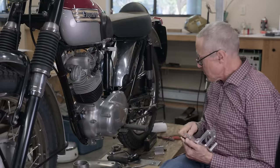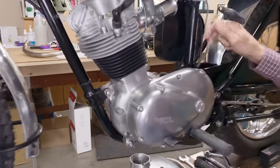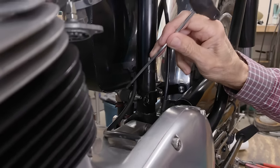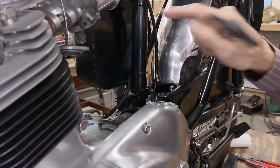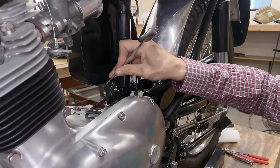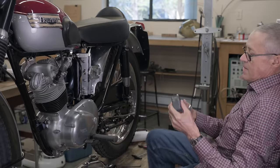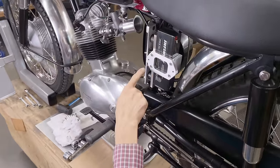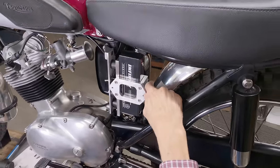I'm going to bolt on the battery mount, but I want to show you that I changed the mount on the oil tank. This used to be a solid mount on the bottom, and now it's one of those rubber mounts — it's isolated, because that's where the crack was right along there. I thought if it was putting any tension on the oil tank when I torque the bolt down — this is solid up top and this is a rubber mount — that's going to isolate this from cracking, hopefully. You can see how the rubber mounts work here. Last time I had one zip strap and it was moving, but now it's rubber mounted.